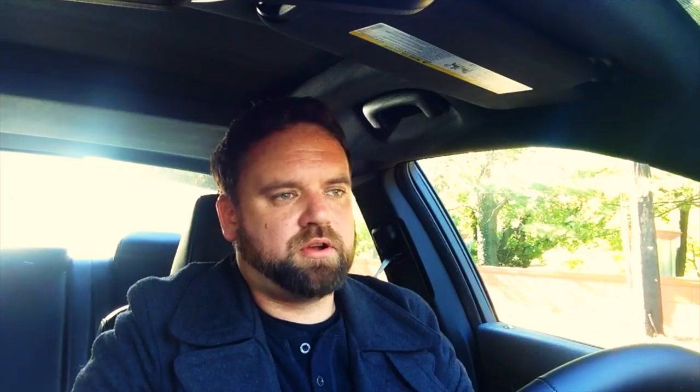So now let's discuss why I have them. I purchased a staggered set of Hellcat rims — they're 20x9 in the front and 20x10 in the back. On the front rims are 275s and on the back are 315s. So when we went to put the backs on, the rim was almost touching the sway bar. It was that close. So had I hit a pothole or any kind of issue, there could have been a big problem with the rim scraping that sway bar.